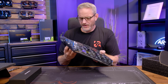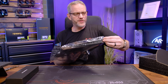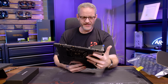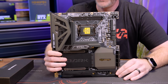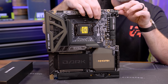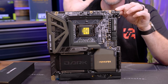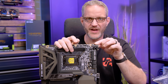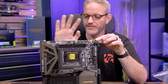But what you're also gonna notice is that they always have this very unique rotated CPU socket. Actually, it does look a little different than the Z690. This is nice. This is so nice. And this is what we miss now with the graphics card stuff. Anyway, as you can see, everything is rotated. So you've got two DIMMs up here, channel A, channel B. I told you in previous videos, high-end overclocking boards typically only have two slots for sticks, and that's because of the fact that it's less stress on the memory controller to have one stick per channel. This is an overclocking feature first and foremost.